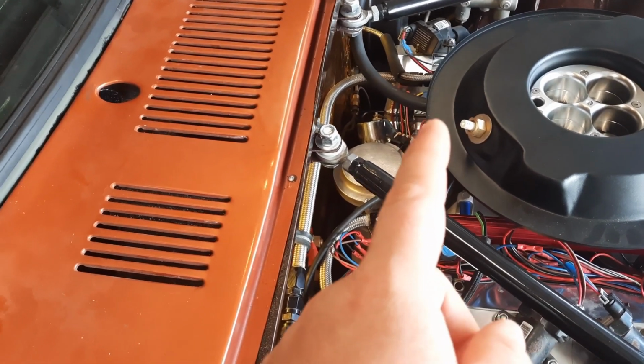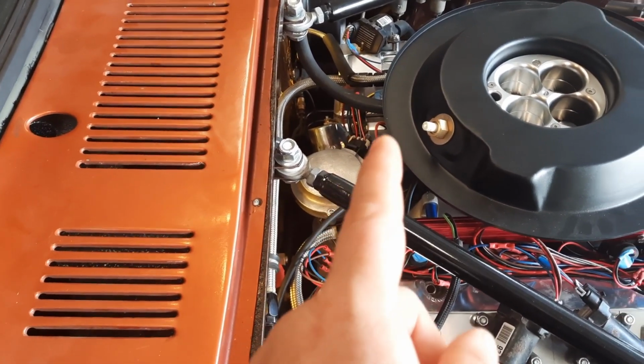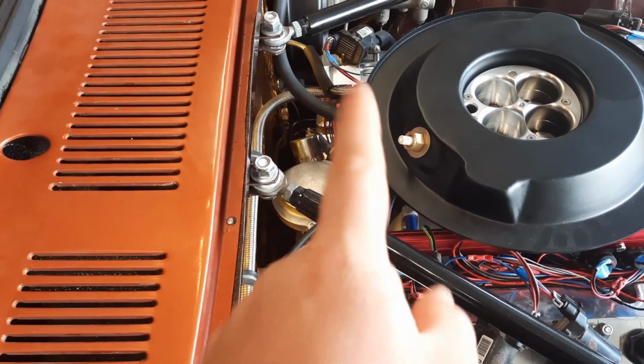Now, going along with my wiring problems, the cam sensor or the Vortec distributor, now that I figured that out, there wasn't originally any kind of layout on DIY Auto Tune about how to wire this up to the MS3X. They now offer this part through their website, but originally I had to buy it from EFI Connection, and their documentation on how to wire it wasn't all that great, so I had to find documentation online, and come to find out I had 2 of the wires flip-flopped. DIY AutoTune now has a document on how to wire that in, so I got that fixed.